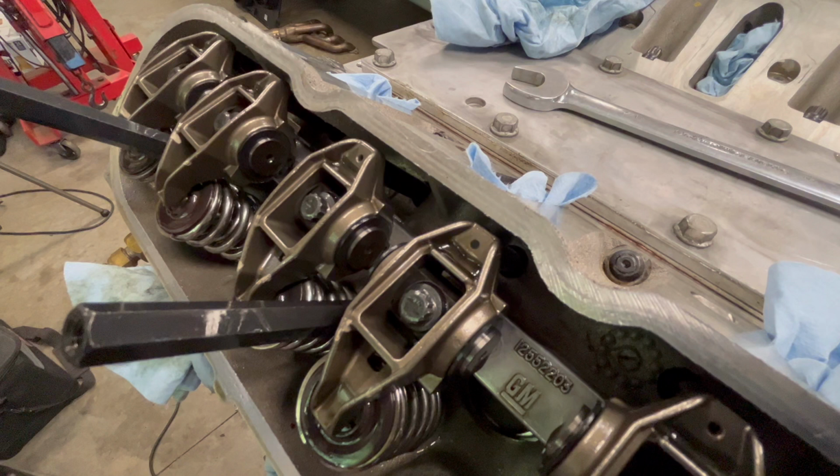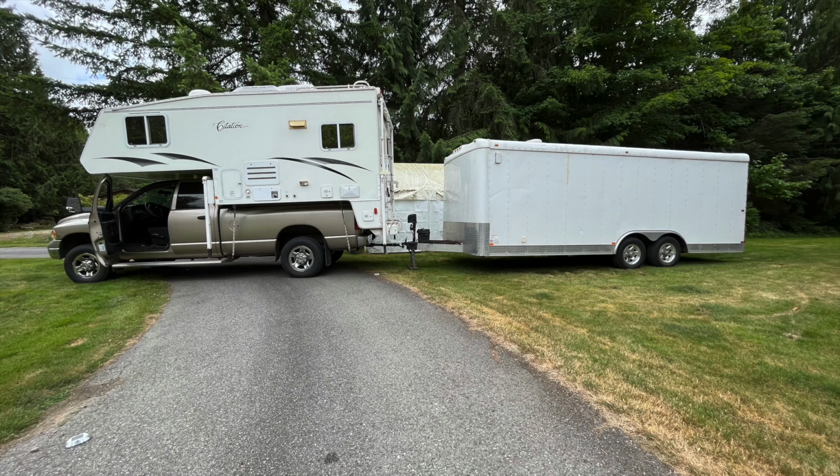In closing, I left the pressure on it for maybe 30 minutes, walked away, came back, and there was oil coming out of the other rockers. So I figured if it's at the top end, it's everywhere in the bottom end. With the engine pre-lubed, that basically buttons it up. There's a few small things we have to fix, like the headers and a couple other items in the next video, and then we can throw it in the car.